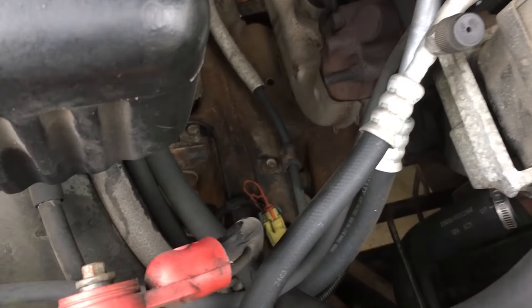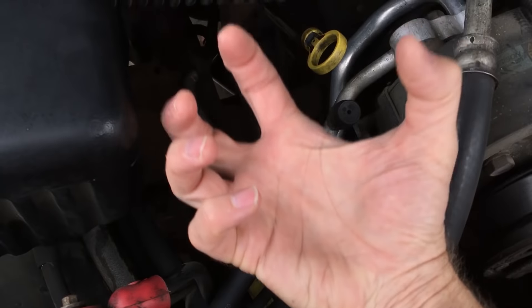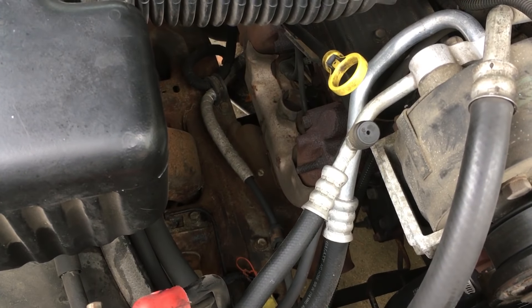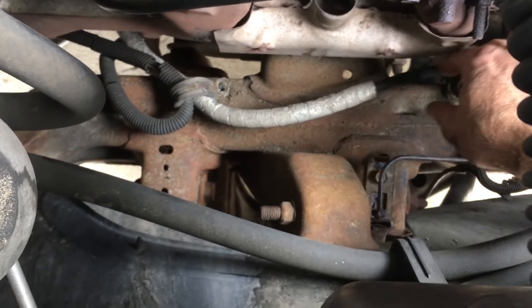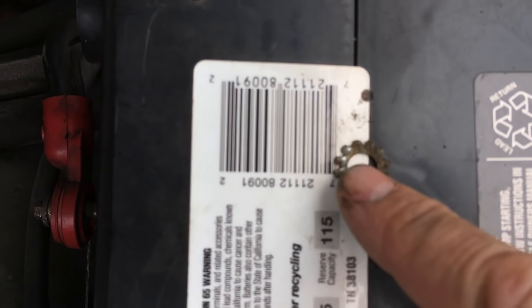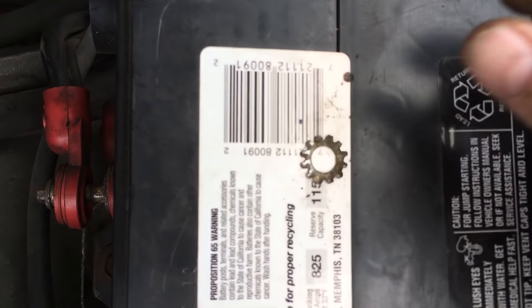The battery cable down there is bolted down to the frame, so if we undo those bolts, when the starter comes out we can drop it down a ways and take the nuts off without stretching or breaking anything. Battery disconnected. Took off this bolt and that bolt there — there are little washers that go under those straps, so just make sure you take the washer out and put it back when you're done.